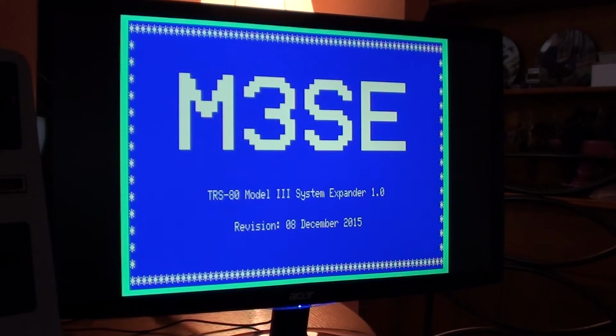I've seen photos of other customer monitors that don't automatically detect that. And if you have one of those, you'll see that the splash screen and everything else you display on the VGA will be stretched horizontally. Every monitor I've seen has a mode that you can set it in to display a 4:3 ratio picture like this. You might have to search through a menu. It might be a button. But in any case, if you want the original aspect ratio, you need to find out how to do that if you're using a widescreen monitor that doesn't automatically figure it out.